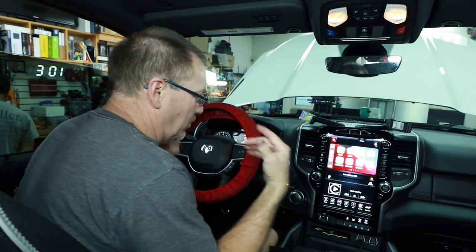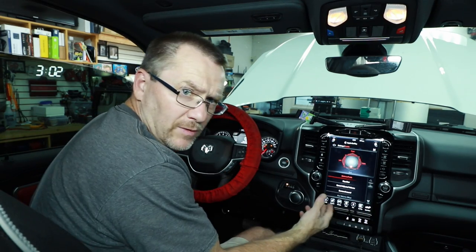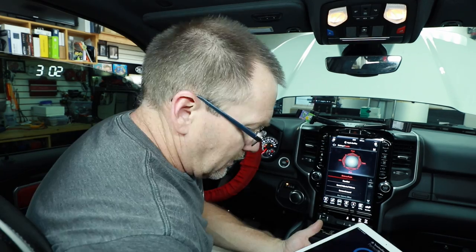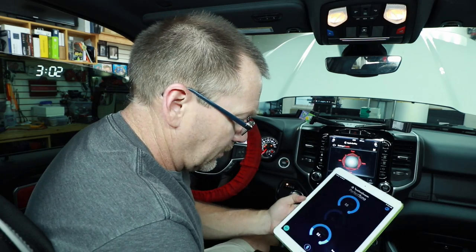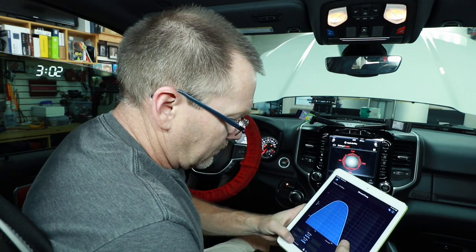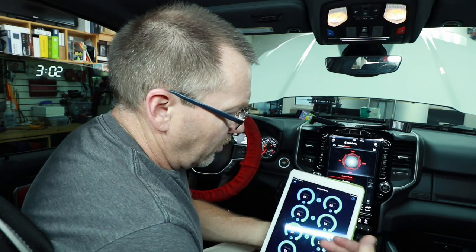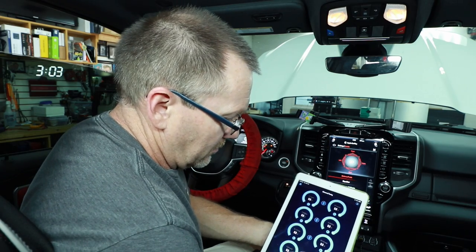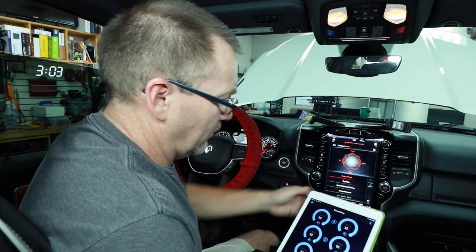Every speaker is making sound — we put our ears on each one. Then we go into the radio settings to check balance and fader. Balance and fader checks out. Back in the app, go to advanced tune and select trim level. Trim level lets us turn on and off, as well as adjust the volume for every individual speaker. Selecting the chain logo in the center unpairs them. We'll turn all of these off and confirm there's no noise.